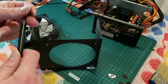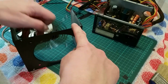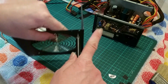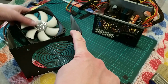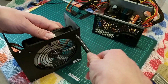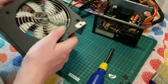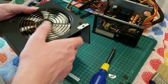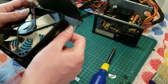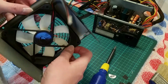So you take your screw, pass that through the hole, take the fan blade and pass that through while holding the screw. And then take your fan, that's the way we wanted it, and then start screwing it together. And don't do it all the way up tight, but it's a good way of having a third hand on these things. Then you can rearrange it all, just with that little bit of play you have. It all fits back into place.